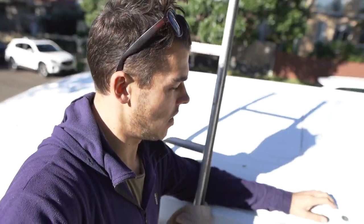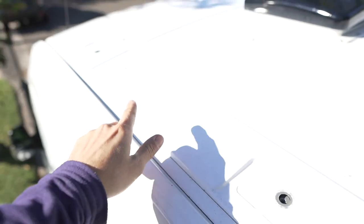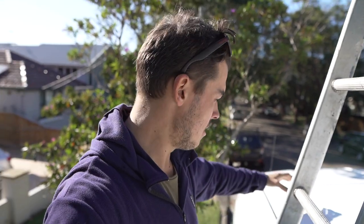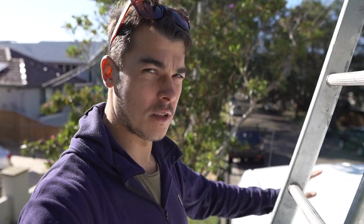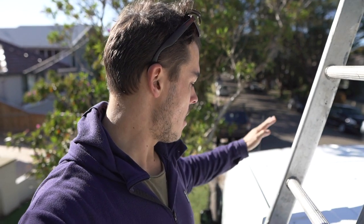The way I'm gonna mount this to the roof — these newer vans don't have gutters like older styles. They've got threaded inserts that go along the van, so I've got four on each side with an M8 bolt that goes in. That makes it very easy to customize your roof rack. I'm gonna have an aluminium piece running down the side with spacers that lift it up, because the roof isn't quite flat — it's got a curvature. I have to raise it up so the flat members don't touch the roof. I'll put a spacer down, then a long strip of aluminium, and my roof rack frame will sit on top.